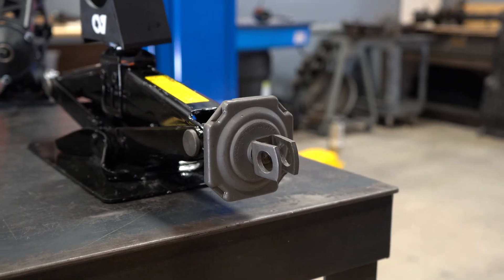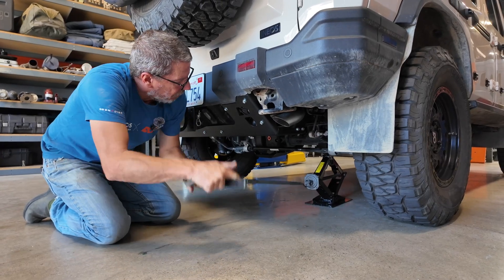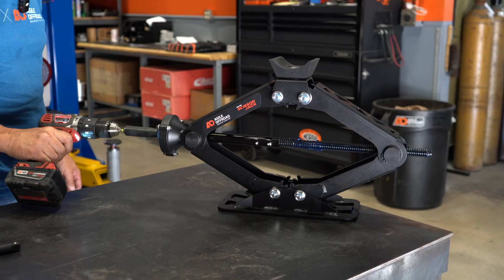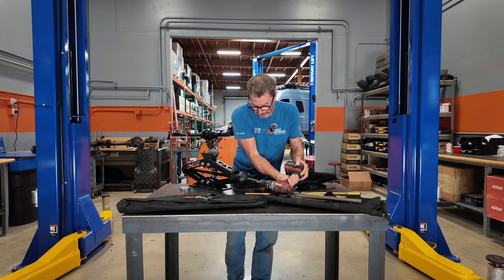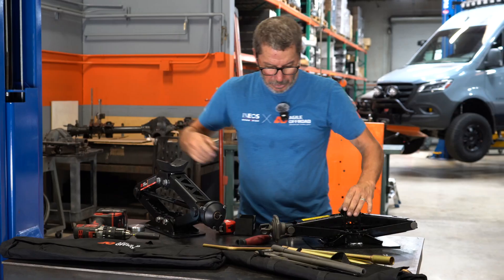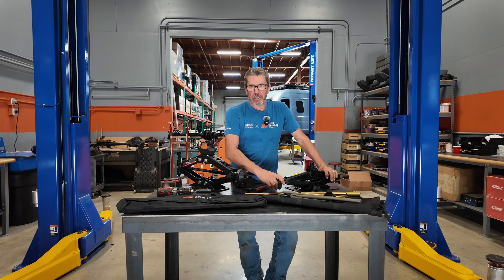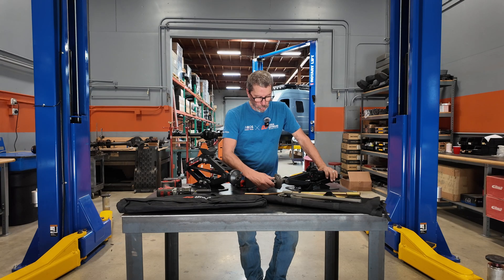This has got a mechanical planetary gear in there, and this also has a mechanical planetary gear in there. This one needs to be hand cranked, and the crank is going to be supplied, or you can buy the Agile upgraded crank system. When you get the Agile jack, you're not going to get a handle with it — you're going to use a drill on this with a half-inch drive. We want you using an M18 or better drill. You're going to get a little bit more ease of lift with this, where this one's going to be a lot more mechanical doing it by hand. I would not and will not recommend for people to adapt this for a drill or an impact. We found over the years this planetary gear is just not the quality that what we're producing in ours. This planetary gear is a little bit sloppier and you're going to destroy it if you're using a drill.